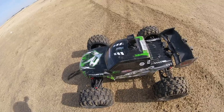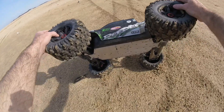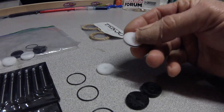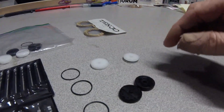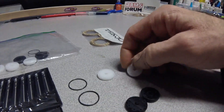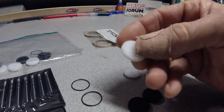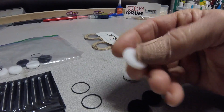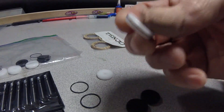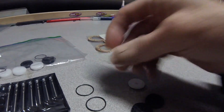Huge shout out to Arma — the shocks feel absolutely awesome. Huge shout out to Mitch Looper as well. This shorter chassis is just such a riot to drive. Here's a shot of Mitch's pistons — these are CNC machined Delrin, both the black and the white ones. You'll notice the O-ring that slips around a little groove that goes around the piston. These are pretty much identical in design to the 6S ones he came out with — his zero rebound setup. This is not going to be a bladderless system, but what it does is these pistons give you ultra smooth stroke up and down in the shock body.